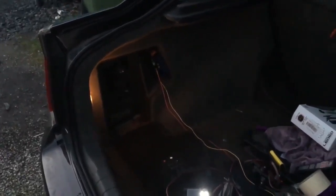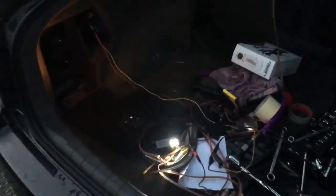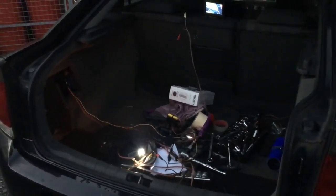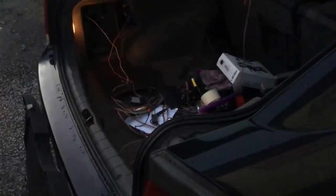If you want a camera that's always on — for example to see who's driving behind you — you can just do it like this. However if you want a camera that goes on when you put the car in reverse, don't use this setup. So we know fuse number 15 is the one we could use for power. The next step is to find your reverse trigger. What I'm going to tell you is not what you should do, but it works. I decided to wrap the cable around fuse 15 on the plus side — the nearest to the end of the car — and then take the reverse trigger over there.